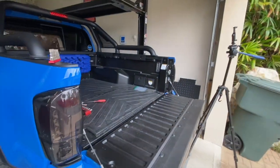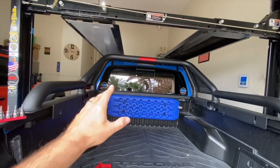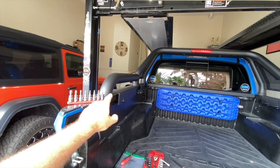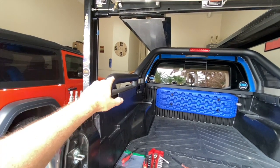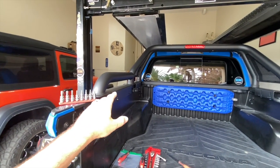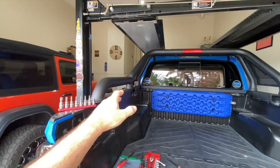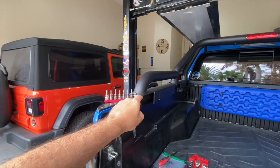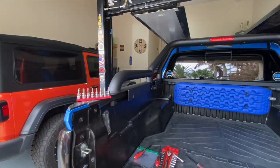What I am going to do is go ahead and remove all of these bolts on both sides to free up the roll bar so that I can lift it up and access that screw under there, get it out, and find the right one — a flat head, hopefully Allen keyed screw so that it sits flat. I'm also hoping I don't have to mess with the wiring, and I'm curious to see if there's any damage under there on the bed rail because of the head of that bolt sitting on it. So let's get started.